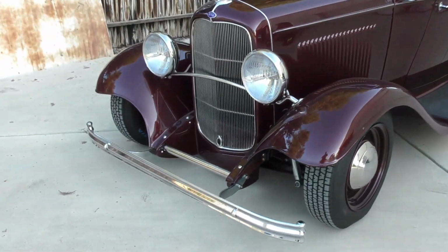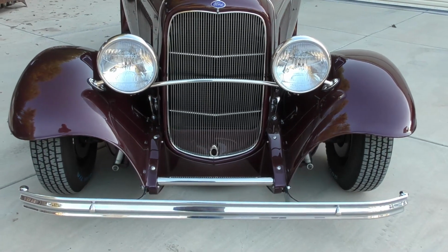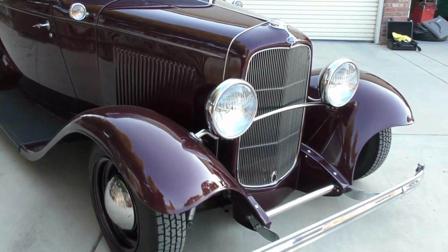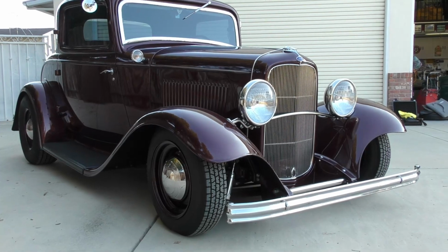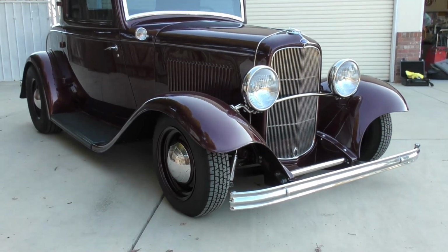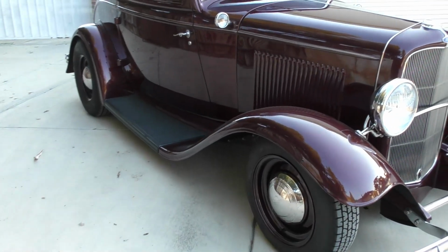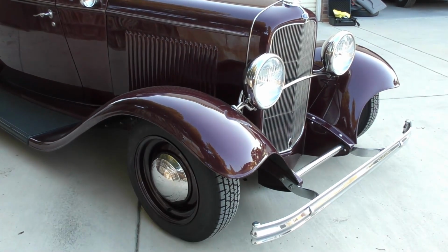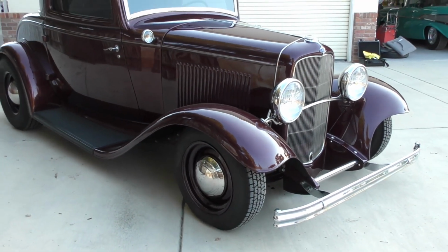Chopped, not filled. Of course, other than the cowl vent that we just talked about. Underneath the hood here is a Ford that has a 302 V8 4-barrel, very healthy. Appears to have some early 60s performance components on it. Exhaust manifold, C4 automatic transmission, Ford 9-inch rear differential back there with the buggy spring. Very, very traditional looking hot rod is what I'd call it.